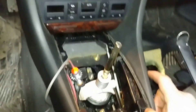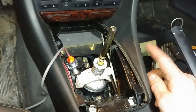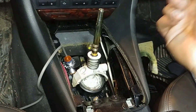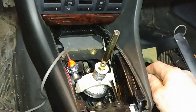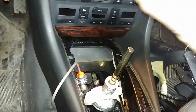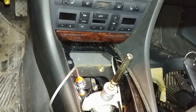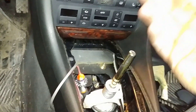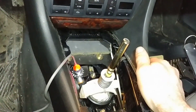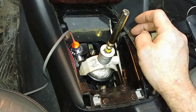Even with the typical manual transmission remote starter operation sequence, if you were to leave a window open, anyone could reach in and put the car in gear — and the remote starter has no way of knowing that. That whole sequence of parking brake up, key out, engine stays running, open the driver's door, get out, close the door, lock the car — it's great, but if you leave a window open and somebody puts it in gear, bad things could happen. This setup is safer.